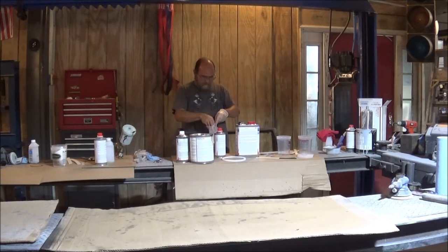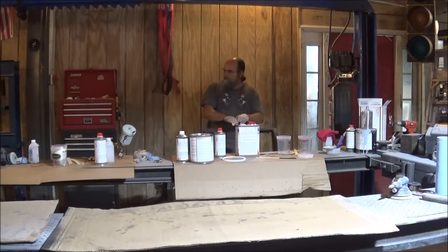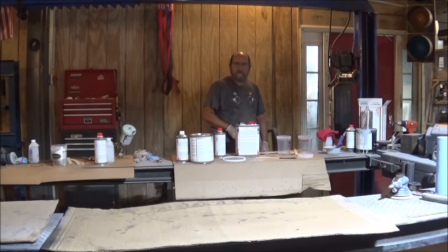Got the seal broke on both of these cans. So, got my gloves, got my face mask. Don't want to be breathing on that stuff. The gun's been cleaned again. Alright, this stuff mixes 2 to 1. I'm going to go ahead and get some mixed up, get the gun loaded. Now I'll see y'all in the booth for some clear.